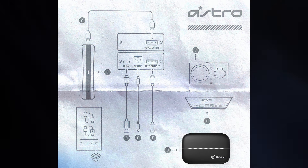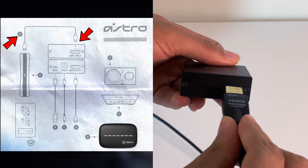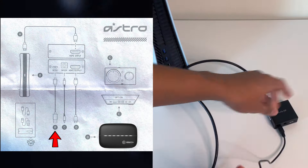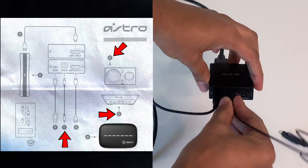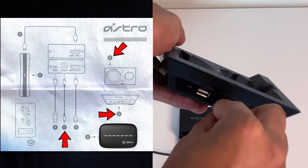You don't want to put your HDMI cable to your TV because you'll be using that cable to output to the Elgato capture card. Go ahead and place your first HDMI cable from the PlayStation 5 to the HDMI input on the Astro adapter. Next, you want to plug in a USB cable to power the adapter — you can use a power brick you might have or even the back of the PlayStation 5. You'll also need the optical cable to plug in from the adapter to the base station or mix amp that you might have.